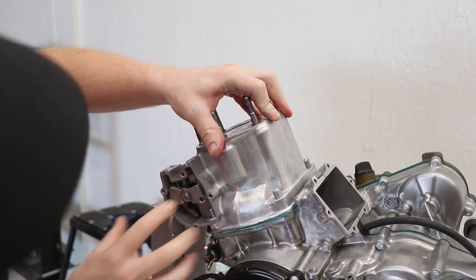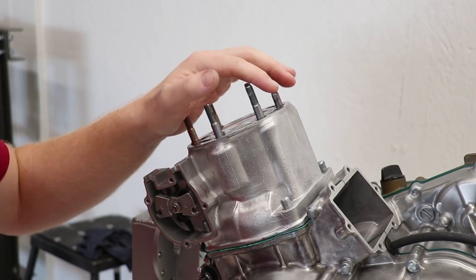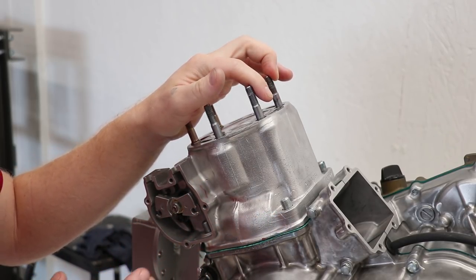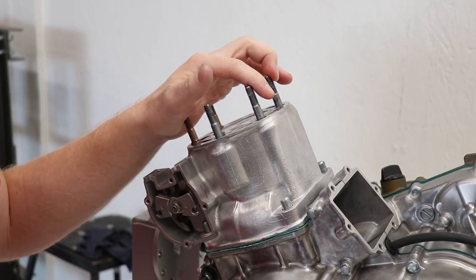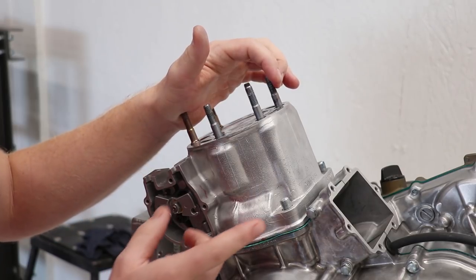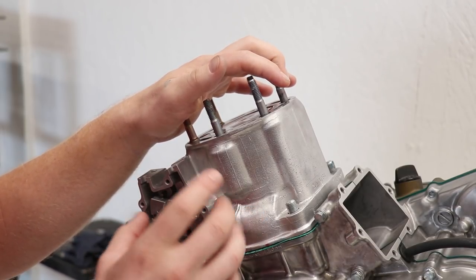With the ring started inside the cylinder, I'm keeping the cylinder square with the cases and squeezing the piston down inside. Slow and steady, getting it lined up with the studs — once on the studs it should just slip right down. Man, that is looking fresh! I love how the cylinder looks with the cases. Having new dowel pins inside the studs helps so much, and having anti-seize or grease on them makes everything slide together so much easier. Down the road if I have to pull this top end off to rebuild it, the cylinder will slide right off without any issue — no corroding or rusting dowel pins. Now I just need to locate my nuts for the cylinder and get it torqued down.